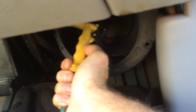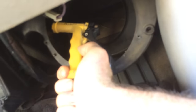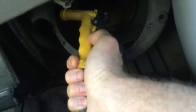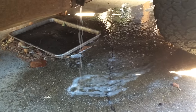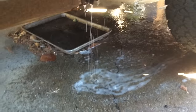Put a towel on the floor and then just aim right up in the side with your hose nozzle. Probably don't want to use too much pressure when you're doing it — set it kind of low, and if you've got a wide spray option, that's the best thing for full coverage. The soapy water is going to run out of the bottom of your truck. If it doesn't run out of the bottom of your truck, stop spraying because you may have a blockage in the drain hole.